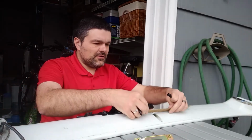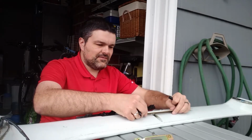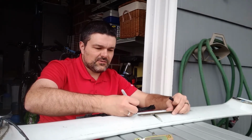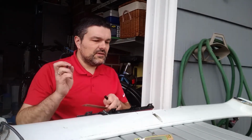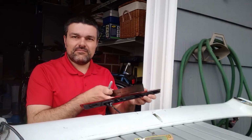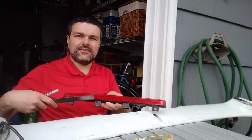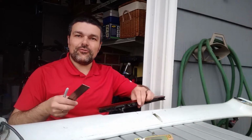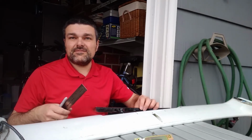Marked my center point. I want to cut maybe 3 inches either side of that, because it looks like there's some supporting stuff in there, and then we'll figure out how we're going to chop this and then chop this bit. So I'm thinking I can take a multi-tool, cut, and then this is just a strip of LEDs inside along here. Chop off the end of the strip and put the two pieces back together, and hopefully it's clicked in by these clips, so maybe just clip them in and that'll hold it with maybe a bit of RTV silicone sealant.